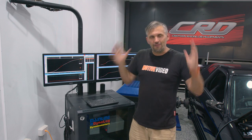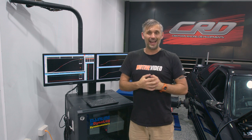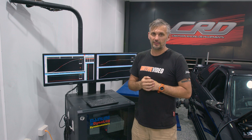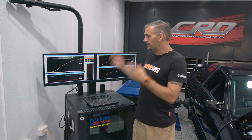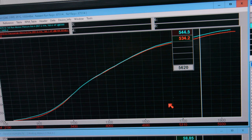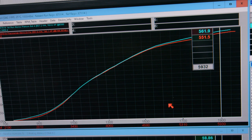I've been waiting a very long time to get the results from this test. In fact, I bought that Nismo inlet about 18 months ago. First up, I'm going to say this: it works, it makes more power. But here's the thing — it does some of the things Nismo said it would do, and some things it said that it wouldn't do. Basically, Nismo said to expect power increases between 4,600 and 7,600 RPM. Well, we got power increases below 4,600 and above 7,600 — and that section they said you'd have more power, we had no change.